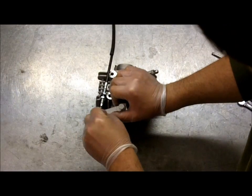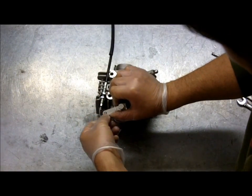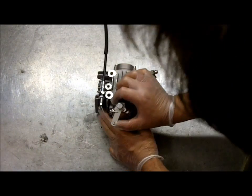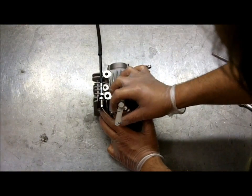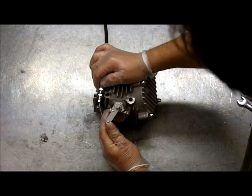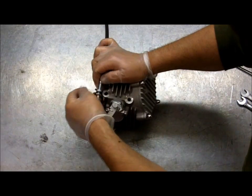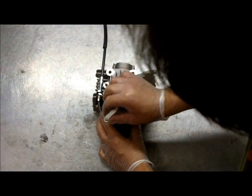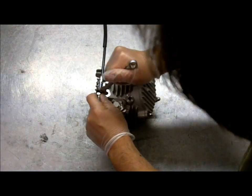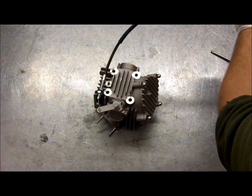Wind the arm forwards right the way round and get the cable in — doesn't help with gloves on sometimes. There she goes. Now what we need to do: we know the arm stops there because we can feel a little bit of resistance as it's hitting the end of the valve. We're now just going to take up that slack by backing that adjuster off. We know the arm's making contact just about there, so we want to give it a little bit of play and adjust it up to about there. You do need two 12mm spanners to nip these up. And that now is actuating the valve — very light action, operating off your finger up on the handlebars.